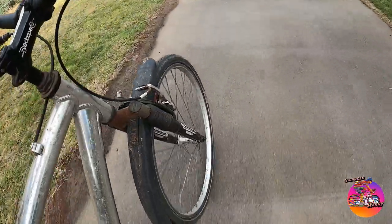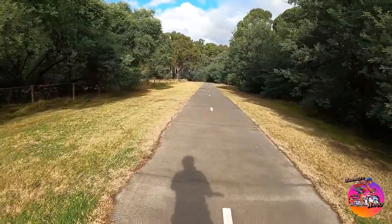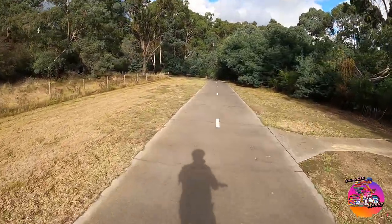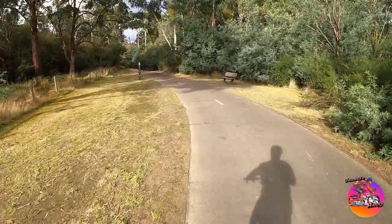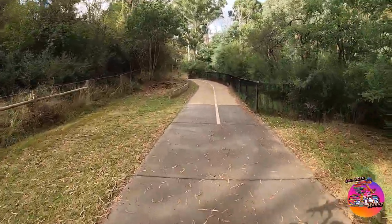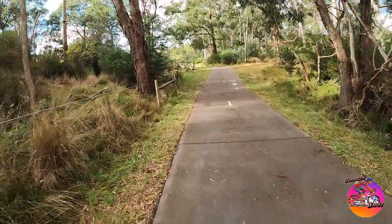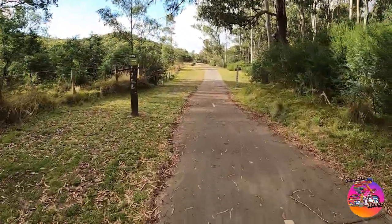I made up a different front wheel — I wanted a quick-release front because at the time I was putting the bike on the roof rack. The back hub was a bit of a saga; I bought it off Chain Reaction or somewhere and it had a big axle on it that I didn't pick up when I bought it. So I filed some flats in the axle and filed the dropouts a bit bigger to get it in there, and it works fine — it's been a good hub. I've lost count of how many rims I've put on it — at least three, maybe four.